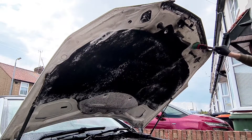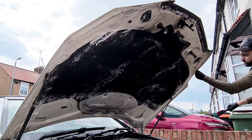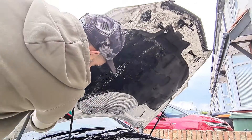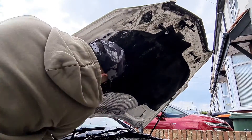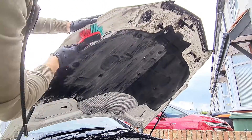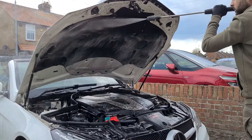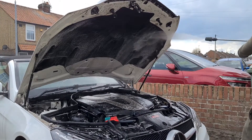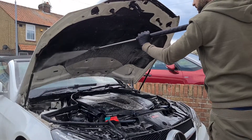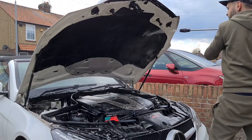We're now going to go for the contact wash using our dedicated brush — this is a soft bristle brush that I normally use on wheels. I always start with the bonnet first because any drips of water and chemicals will obviously go on the engine. If you need more product to remove any harsh areas, just spray it directly into the brush and carry on working. Work your way around the bonnet getting into all the tight areas, then do the carpet area at the front of the bonnet. Using the pressure washer I'll rinse just the bonnet to stop any product from drying and causing stains. I'll also rinse the windshield and any other bits that may have got chemical on them. I always clean the bonnet first, then move on to the actual engine itself.